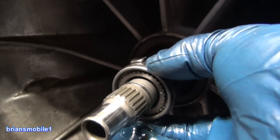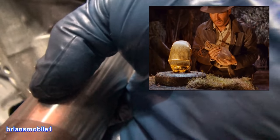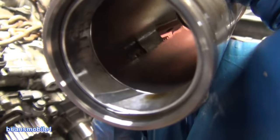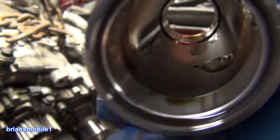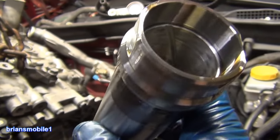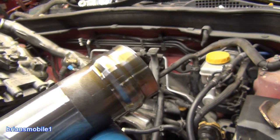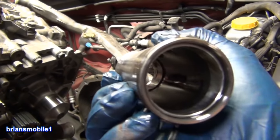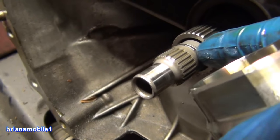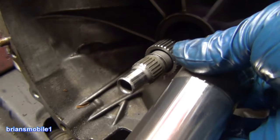Let's set it on the ground so you can really get a look at it. That's a sleeve for the front pump drive. You've got the bushing — see the little lines in it that help with lubrication and keep it from leaking — and then those two tangs on each side drive the front pump. In this case the front pump is further back in the transmission. Pretty cool design.